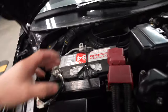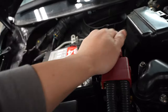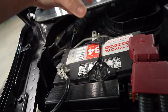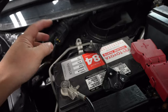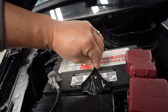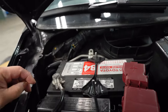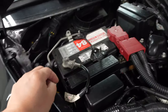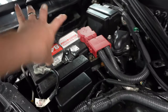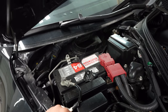Now you don't have to worry about fishing for the hook in the back to hook into the battery cradle. That's the easiest step and a lot of people just try to cheat and force it out. Once you remove the terminals, you should cover the positive so it doesn't ground out — cover the negative too. Then take the cradle out, remove the 10mm, and once it's released you can see how it's hooked in from behind. If the cowl is in the way, you can't actually see or access that.